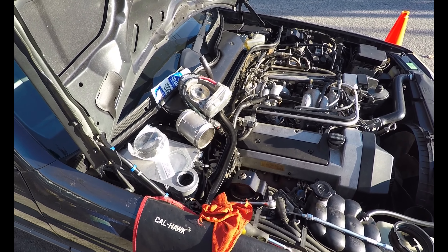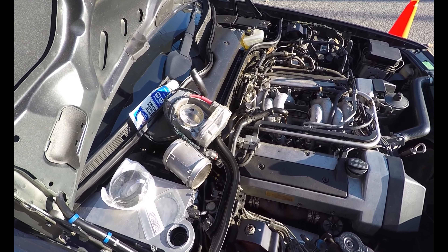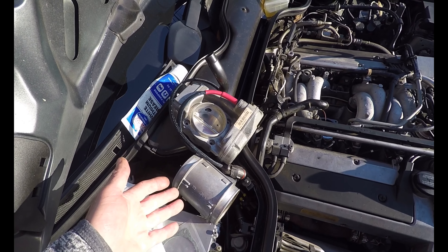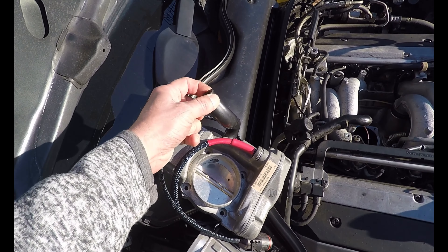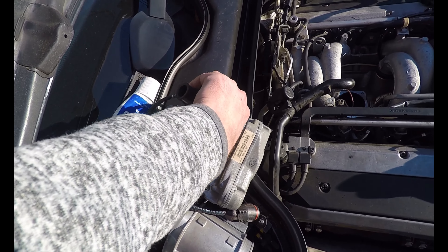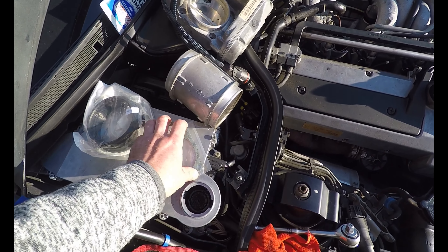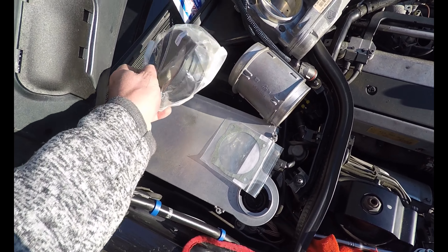Hello Brian, this is Victor. I'm going to install your throttle body back in the car today. The throttle body is repaired — had it done a couple of days ago, new hoses attached. This is the one you want to have replaced regardless, because you're going to have to squash it to install the throttle body back. The original one will really break off. We do have a new gasket.